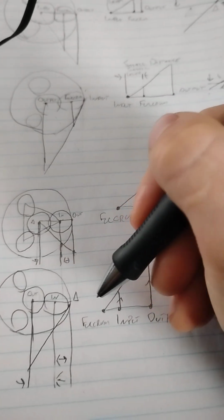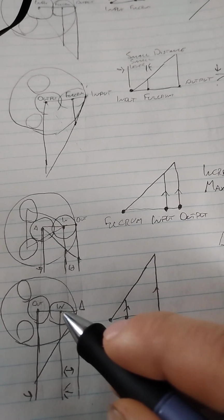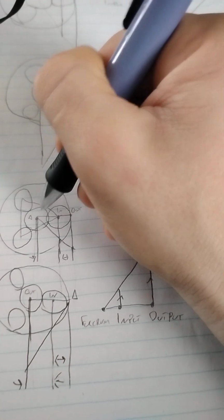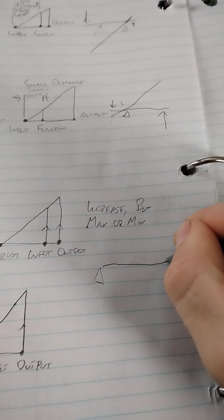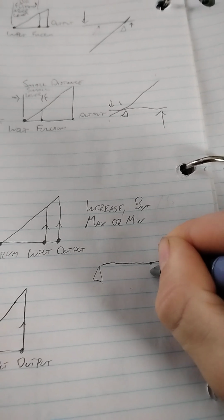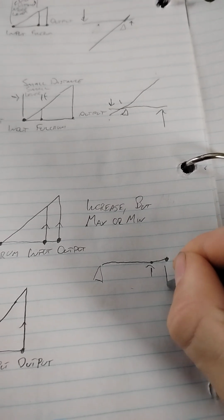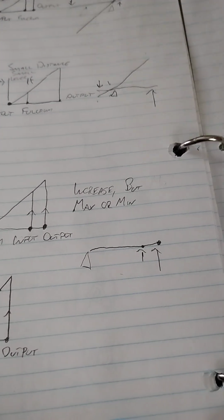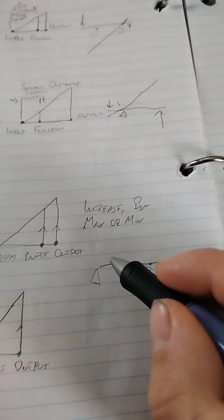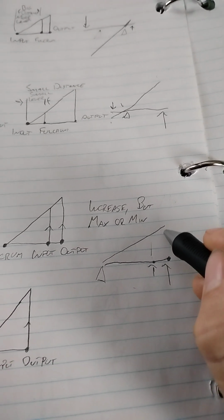And then if we were to invert that, with our fulcrum being our ring gear, then our planet would be the only radius between the input and the fulcrum, where here we have 2 radii between the input and the fulcrum. And so looking here, that would be like having an input. So there's our output and our input. For a certain input here, we will get a bigger output, right? That's a reduction in torque, an increase in motion. So actually, we would call it an overdrive, because if we move it like that, the input has moved some, but the output has moved more.